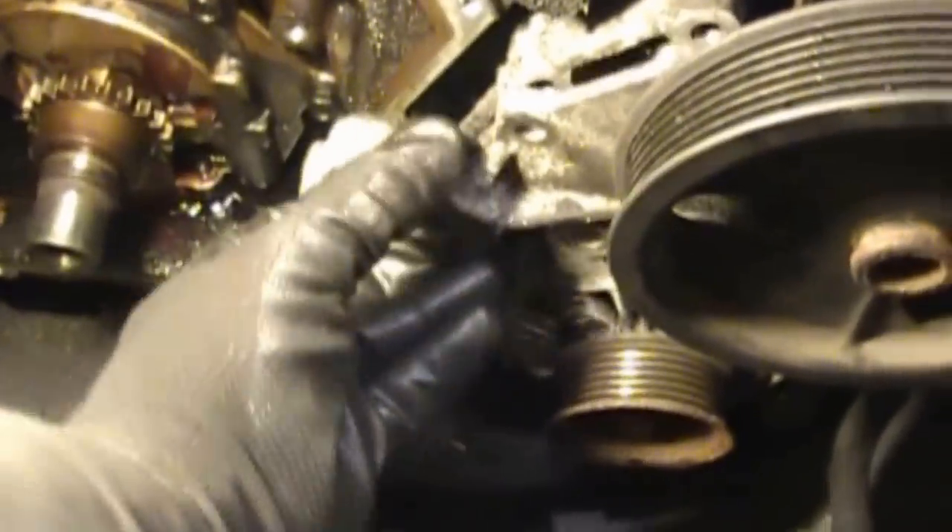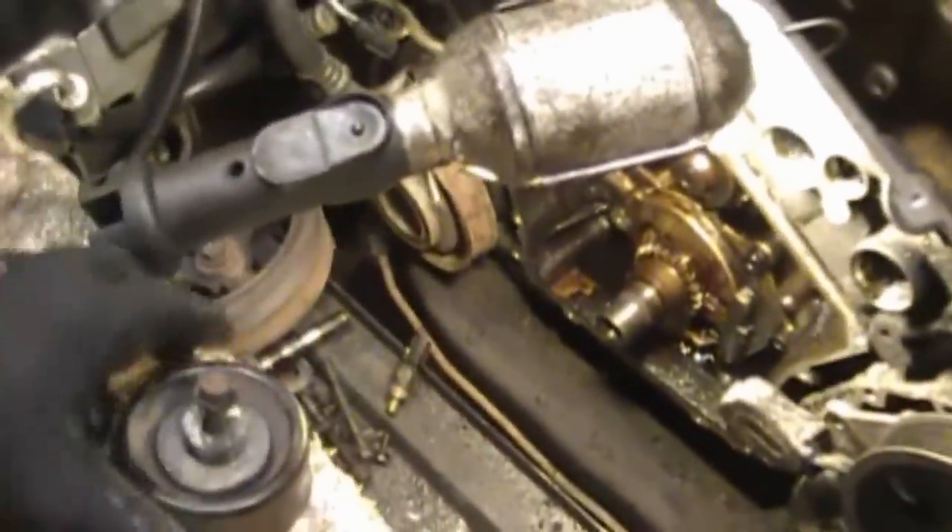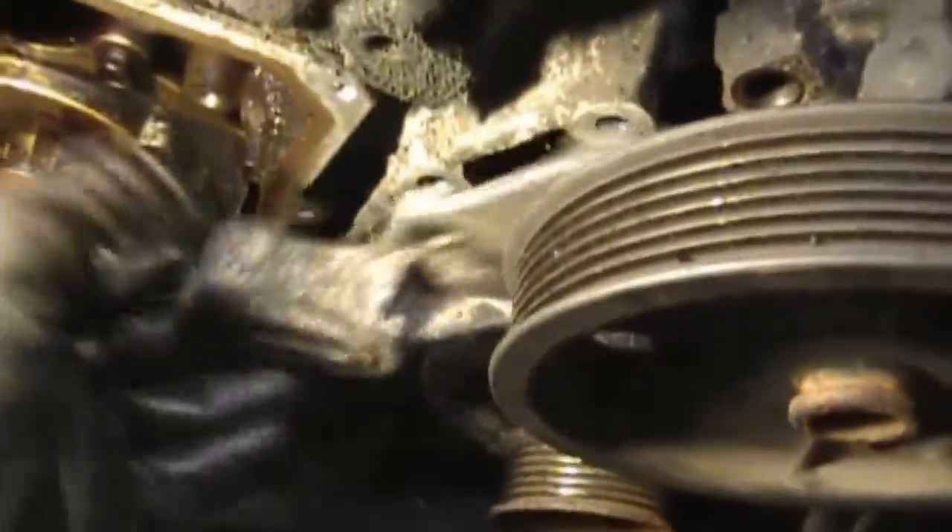You don't have to take the power steering pump off entirely. When they put this power steering pump on, there are a lot of bolts and it's a pain. What I did was take the pulley off the assembly for the serpentine belt and take all these bolts out and pull the bracket out. There's a really long bolt - pull this out, get the pulley out of the way, then you can loosen this bracket up and take the front timing cover off.